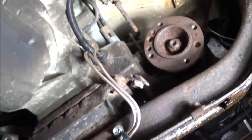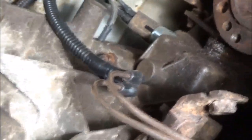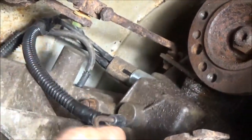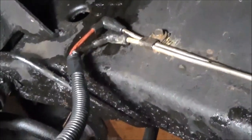But first I'll get these vacuum lines back in. Time for an update — I got the lines and elbows put in. The reason I went with elbows instead of going straight is I couldn't find the straight rubber fittings at the store, so I used the elbow ones. Put some nice loom on there to make it look nice, got some new clamps — the old ones were pretty thin. The other side is buttoned up with loom on it as well.